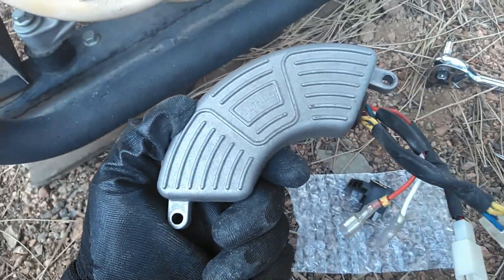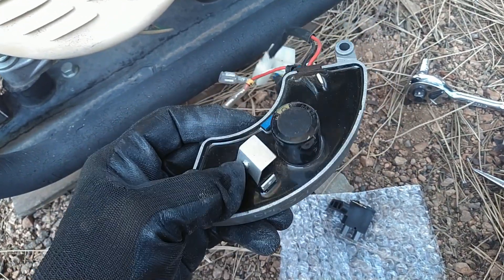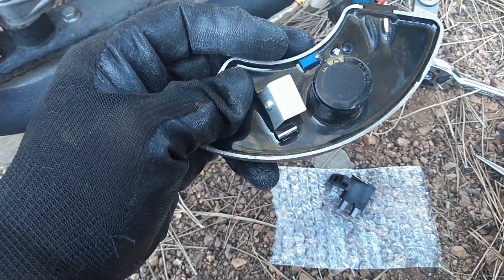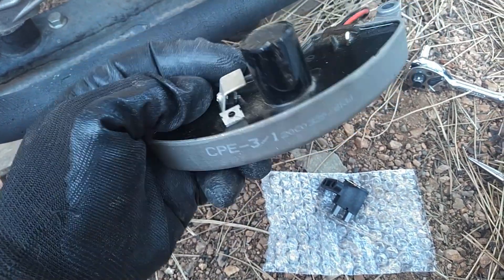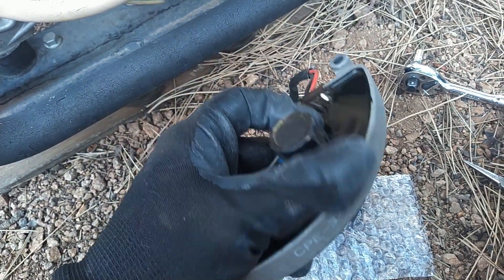This is the old AVR. I don't know if I'm going to try and peel this potting compound out just to take a look inside of it — see what's on it, see if something's cracked. Because it is intermittent: it produces voltage sometimes and then most of the time it does not.